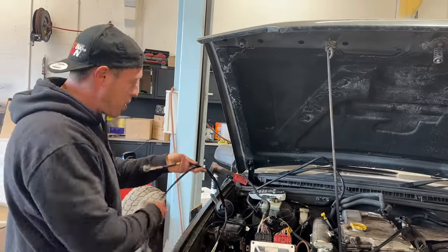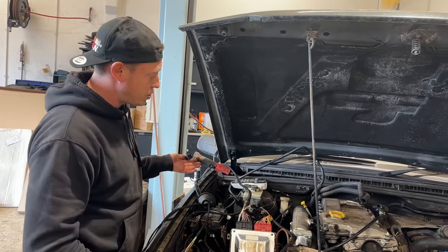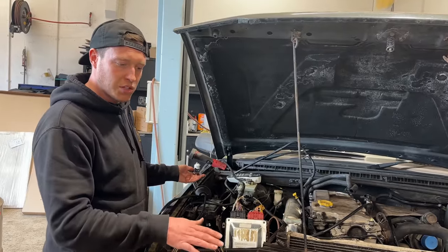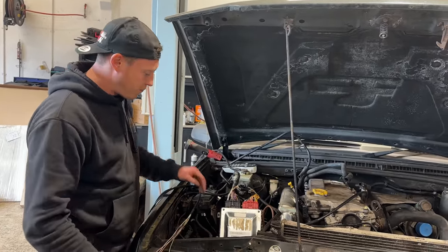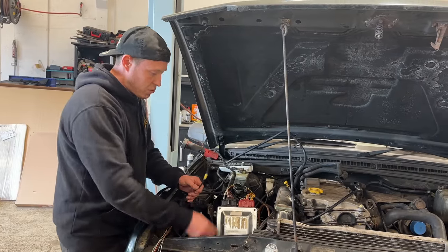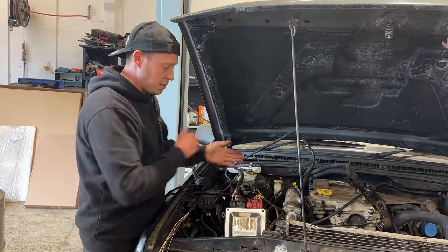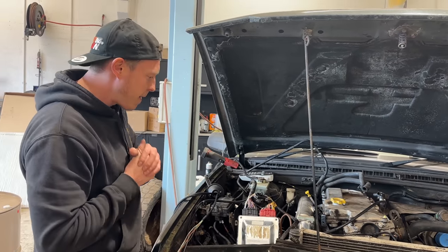We have the throttle pedal and OBD ports we can read into it, and a clutch switch. We won't be running a clutch switch unless we need to. All the clutch switch does is when you dip the clutch down, it lifts the revs up slightly. You can unplug it if you don't like that feature. We have two positive battery terminals and a negative. The ECU is plugged in, both harnesses are connected together, the body side and the engine side. The engine harness is fully installed apart from the air side.